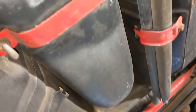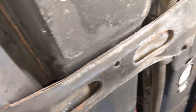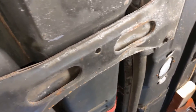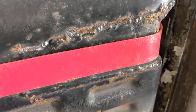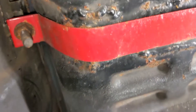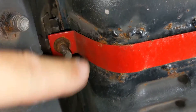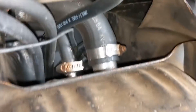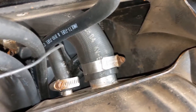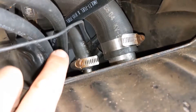The gas tank is not terribly hard to get out. Here's the front strap that I've got to remove - this is more of a structural support, it doesn't actually hold the gas tank. It has to come off. The back strap - you can see the tank - I had to cut and weld this up about a decade ago, that's where it was leaking from: moisture being stuck between the strap and the tank. That has not leaked, which has been nice, though it looks like it could use a little paint. There are five hoses that go to the tank; the main one starting on the right hand side is the main filler tube, and the next one over is the main vent tube so when you're filling up with gas, air can quickly escape the tank.